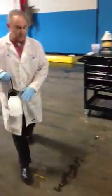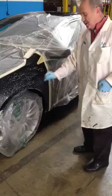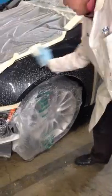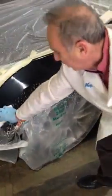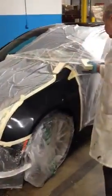Now let's get back to our fender that we went ahead and foamed. You can see the foam is still on there — none of it is on the ground like conventional wax and grease removers. It's doing its job. Let's effortlessly, with the super sponge, wipe over the area where we had the grease pencil. Now let's have the sponge act as a squeegee, going over the entire area. And you can see that it's ready for paint.